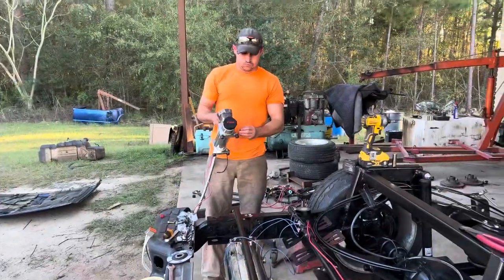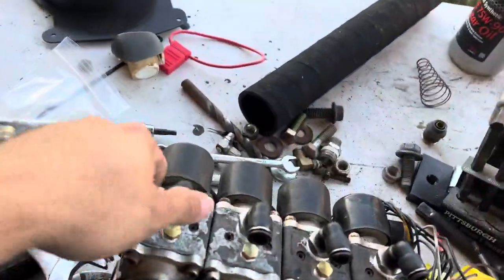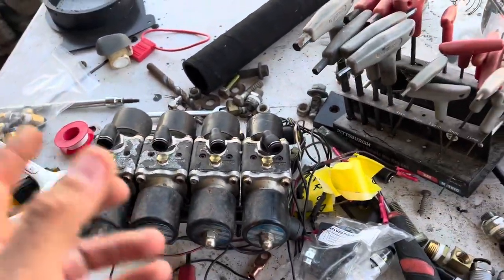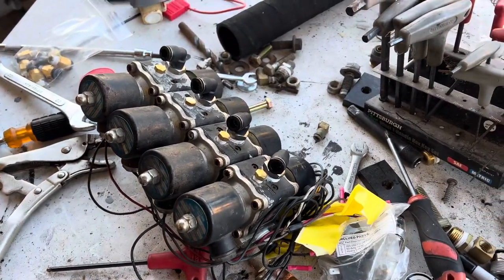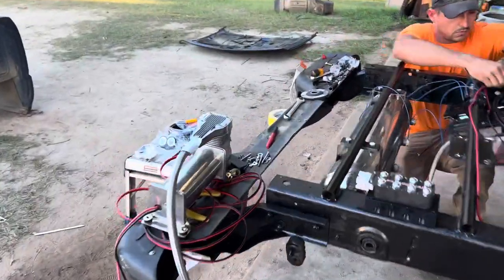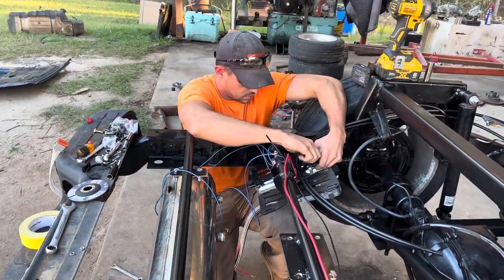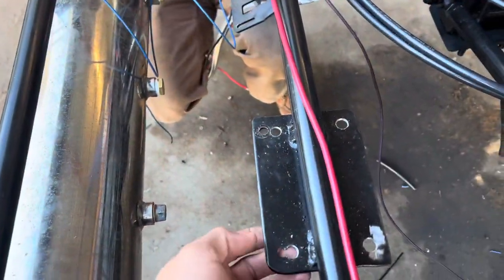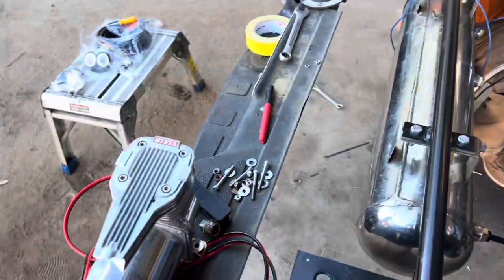All right, so it's Tuesday now. We ran into a couple issues last night — got it all wired and plumbed, but this valve block our buddy Rance donated had something leaking on the inside. We had air coming out of the exhaust port. So Brandon called and ordered some Viair 485 dual pack and a VU4 today, and I had some in stock so I'm just going to swap him out. He's going to put these on today so he can get riding. We had to modify the bracket a little bit, drill a couple more holes and make them bigger.